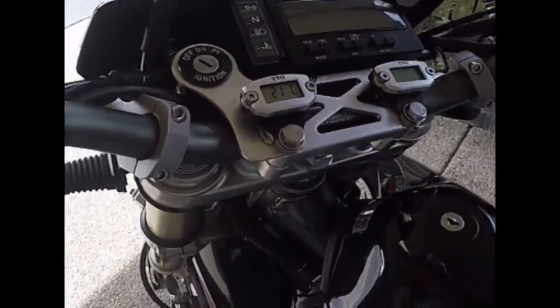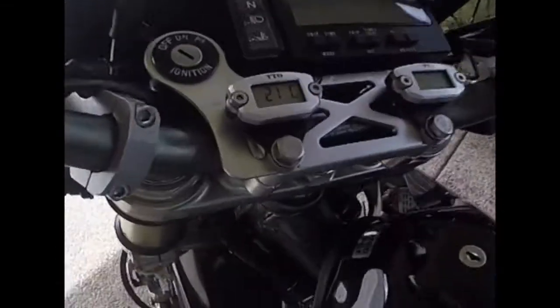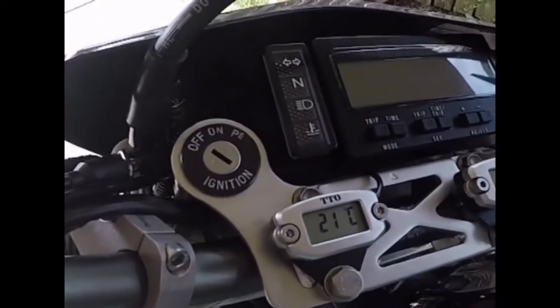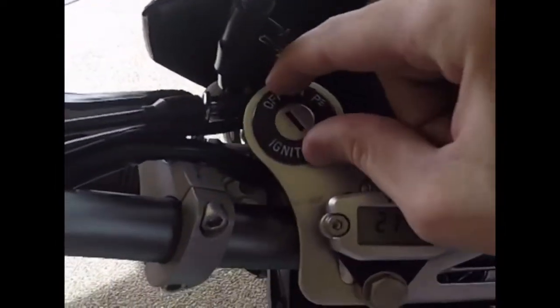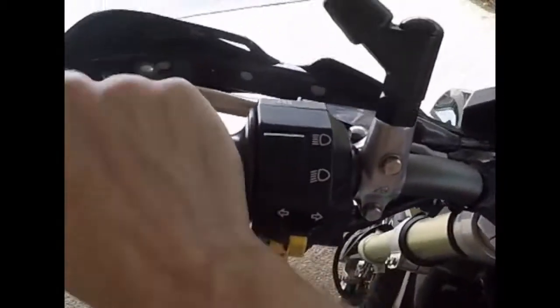I'm going to do a new little cockpit here with a steel plate. So I've just bought some alley 2.5mm thick, and I'm going to make a bit of an L shape panel to go here and up here, and that'll hold some switches. That'll hold the ignition. It'll hold heater grips. I'm going to put some heater grips on.